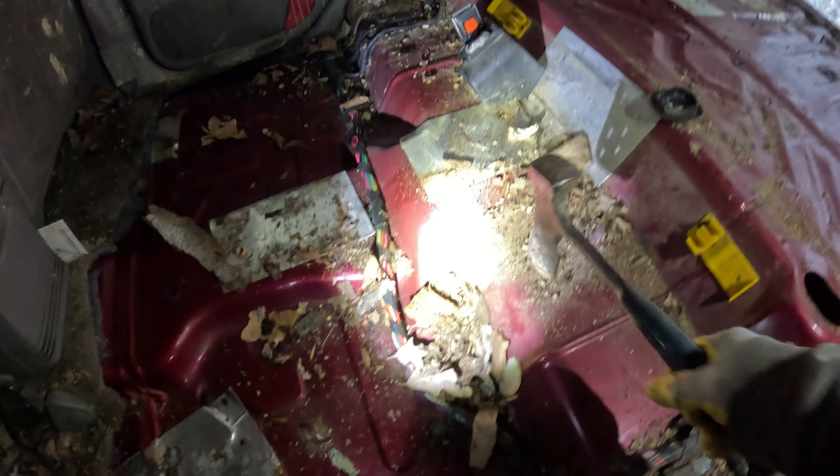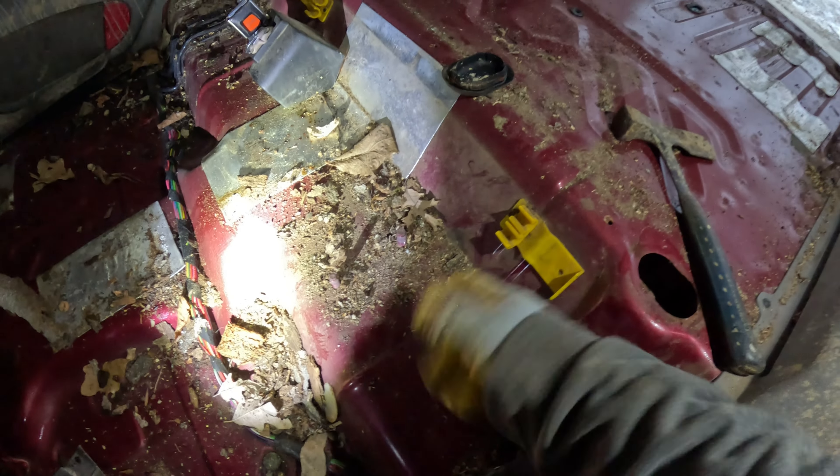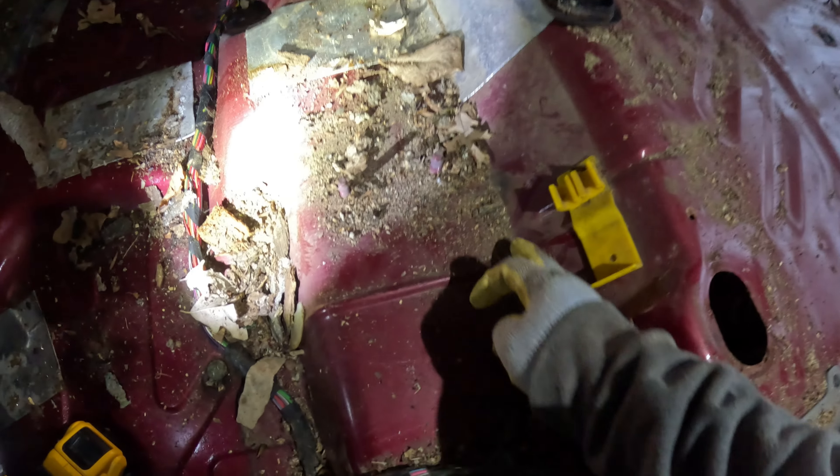On my other explorers I was able to take a hatchet and just whack a hole the size I needed to get in there to work because they were so rusty. This one I don't know — it's the least rusty explorer I have. I'm gonna try it anyway, carve out a square here, see if we can't get a little crazy with the hatchet. We're not using a grinder wheel causing a bunch of sparks — don't do that, you don't want sparks when you're looking for a fuel tank that leaks. Oh, somebody went to Harbor Freight.